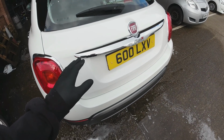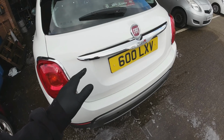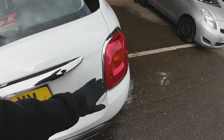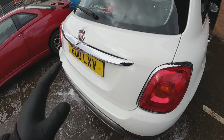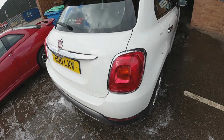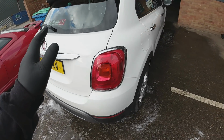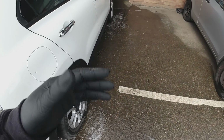You need to get your reviews on paint shops before you get any paintwork done. You need to see examples of their work, ideally a year later, not a day later or a week later, because you really only ever find out about the quality of the paint job later on, once it's had a chance for all those solvents to dry out and so forth.